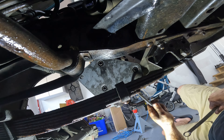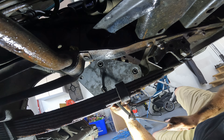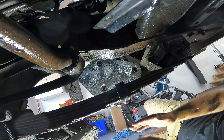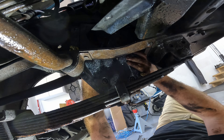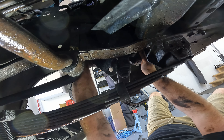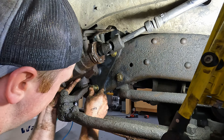Right down here is the steering box, and on the four-wheel drive trucks it's attached to an adapter plate that goes between the box and the frame. Here's the steering brace, which prevents the frame from twisting with the steering box movement.